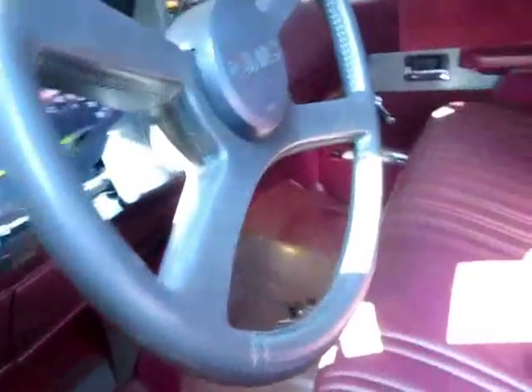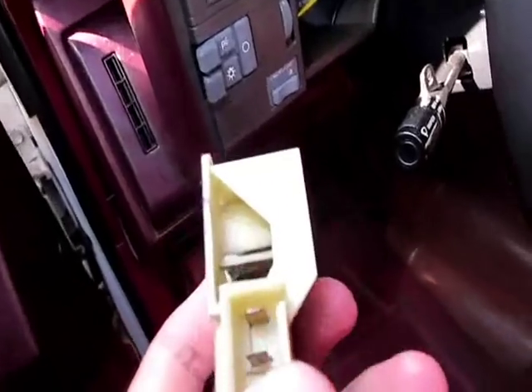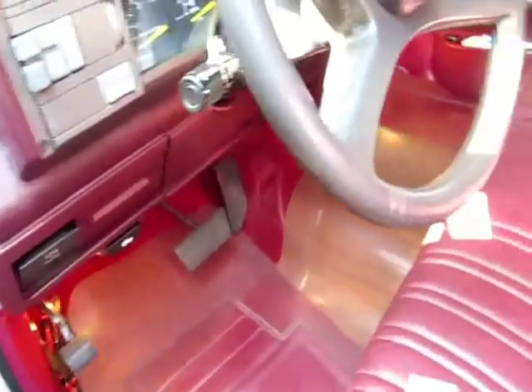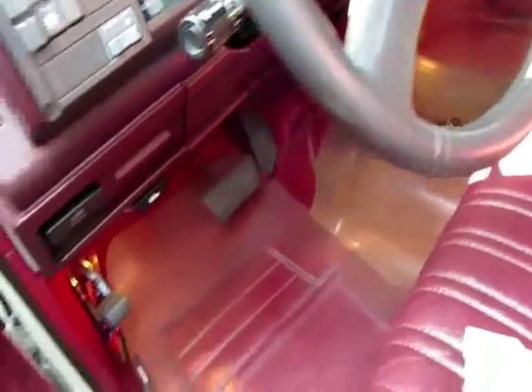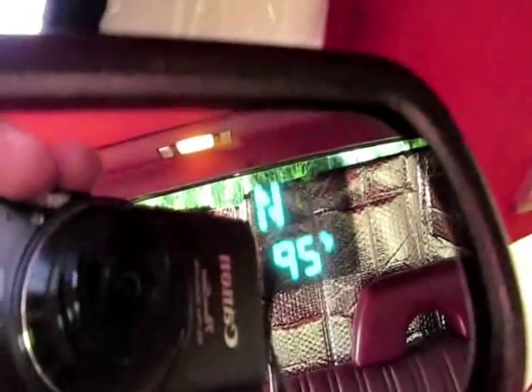Going to Manhattan with stop-and-go traffic — brakes on, brakes off — that's probably why we kept wearing these out. This truck was a New York City truck. The old switch we can probably fix by bending that tab back — keep it as a spare. Always keep one of these in stock if you have an 88-98 truck, they're only about 13 bucks. Now we have to replace the grease dust cap on the right-hand side, it's leaking. Temperature out here is about 95 degrees.